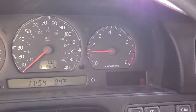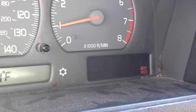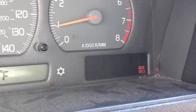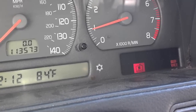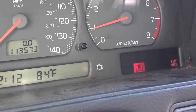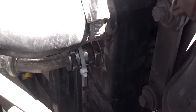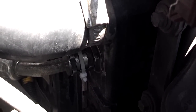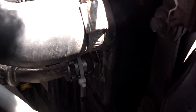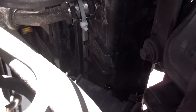I have the sensor replaced — we do not get a coolant light, so it's not the sensor; it's the float in the bottle. Let me see if I can figure out how to clean that float out to get it to go all the way down. I finally got enough sludge cleaned out of that bottle so that my sensor now works. It looks like my radiator leak was actually just that my hose clamp wasn't tight enough, so I tightened it up a few times and the leak stopped. I'm going to dry this area off and test drive it to see if it leaks any more.